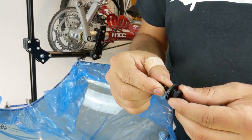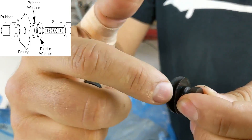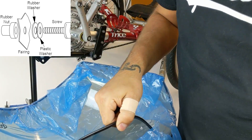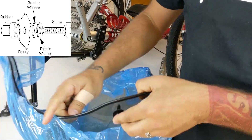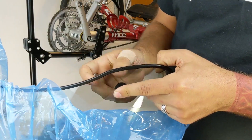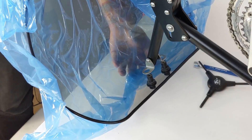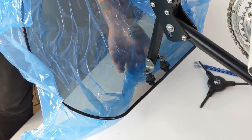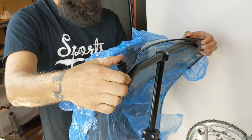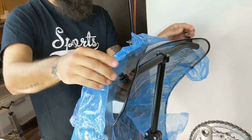Now let's install the rubber nuts. The order of these parts matters: make sure the thumb screw is going through the plastic washer, and then this rubber washer is on the front of the trike when you put the thumb screw through the fairing. Then put the rubber nut on the inside of the fairing. With the rubber nuts loosely installed on the fairing, attach it to the four mounting points of the mount, starting with the lower — slide the rubber nuts to the lower portion and then attach to the top. Don't tighten anything down yet.